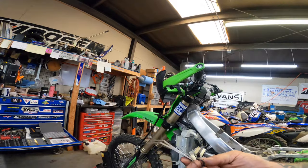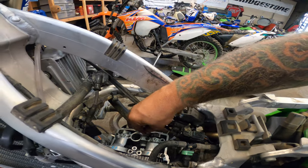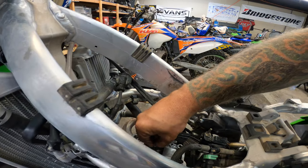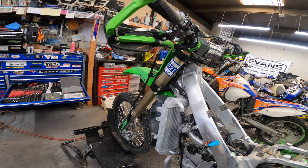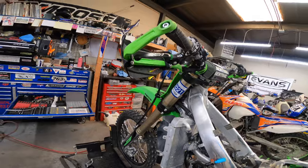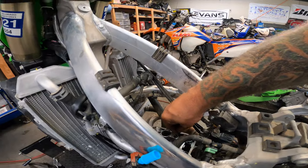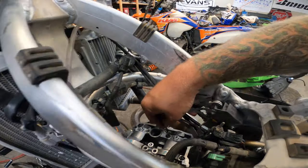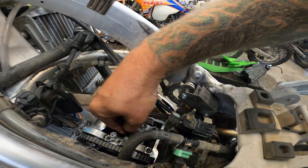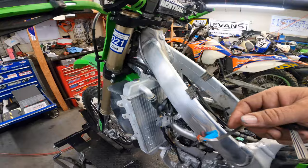Now we are looking for between 4 and 6, so let's get a 5/1000ths. All right, actually starting with a 3. 3 goes. 4. Four is good on that one. Can't get 4 on the left.